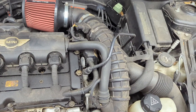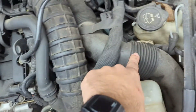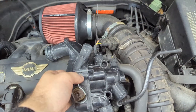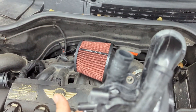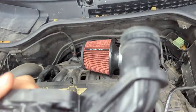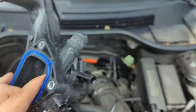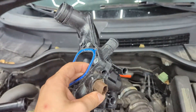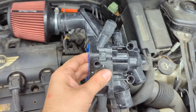The next thing is the thermostat housing. It's right here on the side of the block — it's hard to see. Take off both these tubes, your fresh air snorkel, and it's right there. I have a visual aid right here — the one that broke on me. This goes right up against your block, you've got three screws. You've got all your routing stuff right here — a total of six different hoses going to your expansion tank, crossover tube, block, etc. It looks like an artificial heart. And that's your actual thermostat right there. You cannot replace just this — that's how they get you. You got to get the whole thing. It goes about a foot down, not too bad to get to.